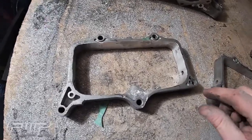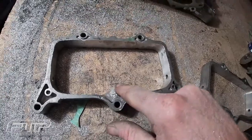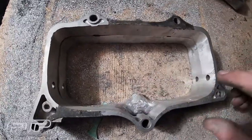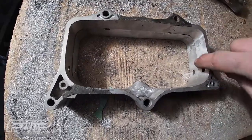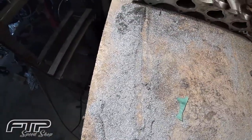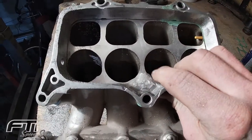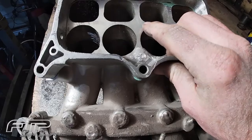I got a little bit of die grinding done today. I got the second one — which will be my lower one — all roughed in and left that little triangle in there. It lines up really close with this one. Once we get it all welded around, all three of them come in here and tidy everything up. It's going to sit on the intake like so, and just keep that little triangle there to keep us from having a vacuum leak, and then we'll blend all that stuff in.